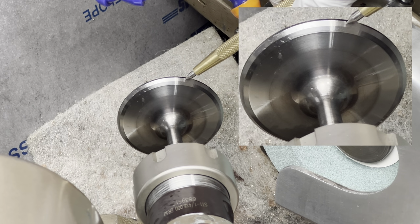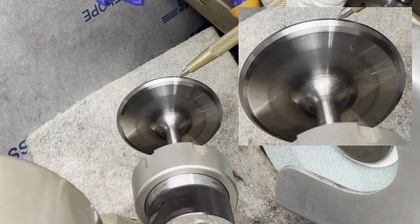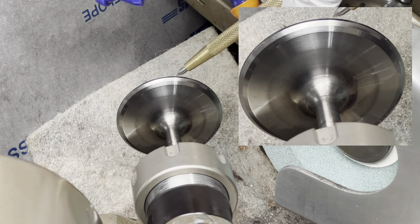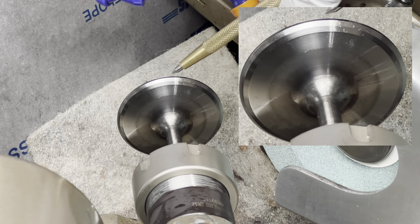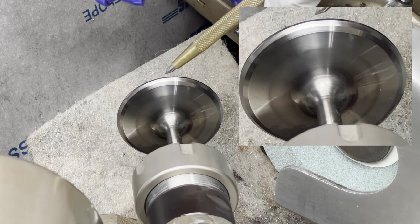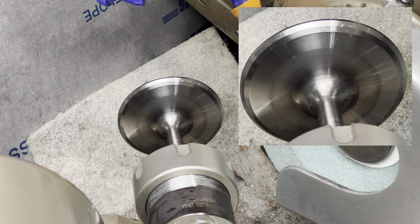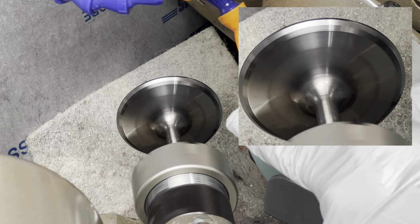Now this is bare titanium. I'll let you know when we get to old valve. It's coming up right now. You'll see a slight difference in color. See, we've got shiny, it's a little bit darker of a color. That is your worn out valve face. And now we're back on bare titanium. So from here to here, that part of the valve is not cleaned up. Just interesting. And you can see it when it's spinning. It's really quite obvious.